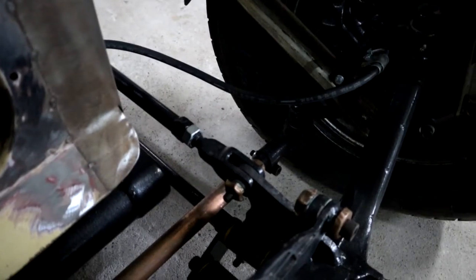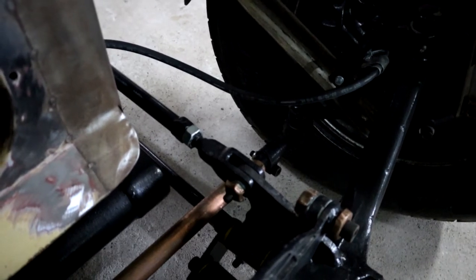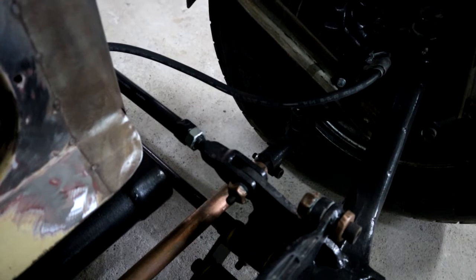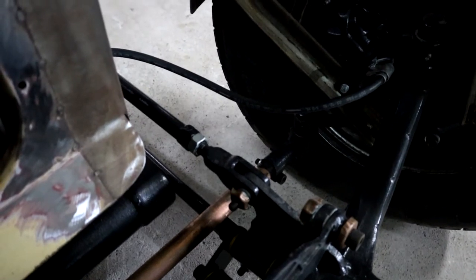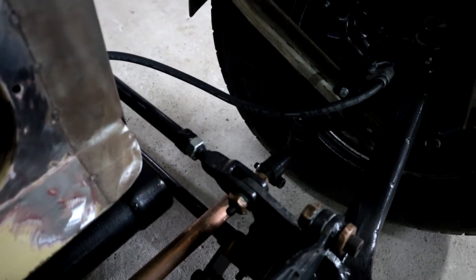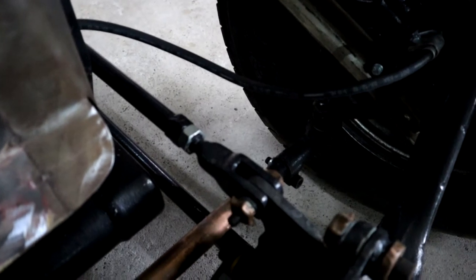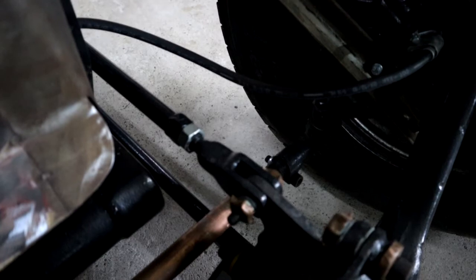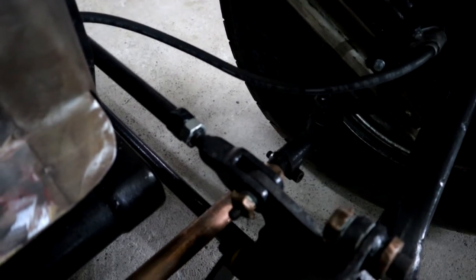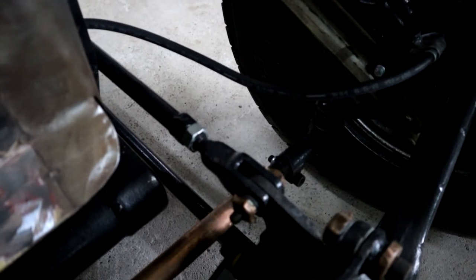The hairpins on either side of the car are essentially what's keeping that axle square to the frame. I can adjust it right there — you can see a nut and thread. To fine tune it is not a problem. By the way I can also adjust my caster with these very same nuts.